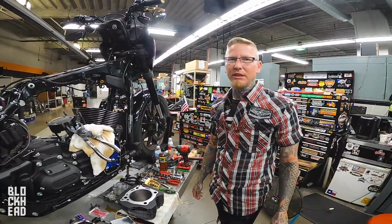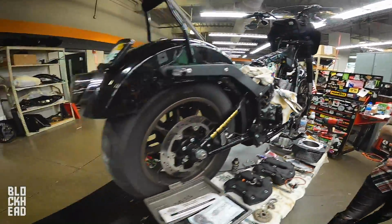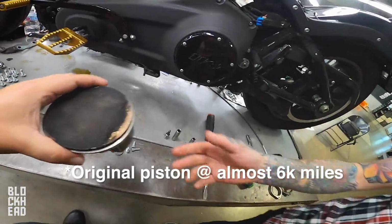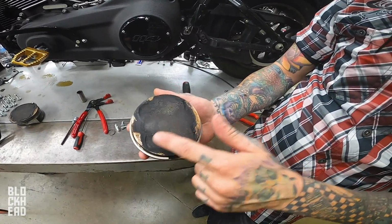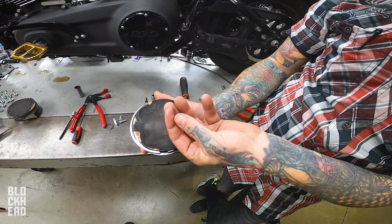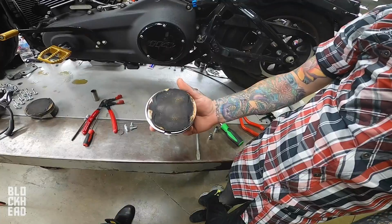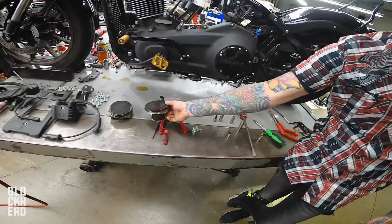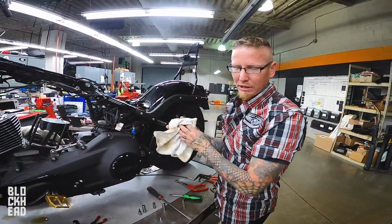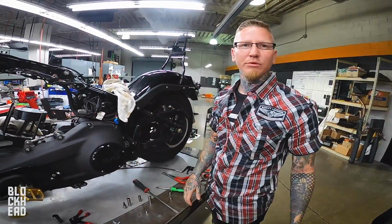I think some of what we were having an issue with was ethanol, and somebody sent a picture of spark plugs that matched the pistons. And really, just to settle this, we're technically right. When you look at this, if you say, well, that looks like oil, technically yeah, there's some oil in there for sure. But this white crystalline stuff that's coming off, I don't know if you can actually see this chunk on my finger, but this is from ethanol. See that stuff falling off? That's byproduct from ethanol. And really the black is too. A lot of it is more ethanol than oil, but for sure there's some oil in there. Eric, I think is your name, you're right. It's just a byproduct. Like I said, if I had a set of pistons here that was running only unleaded, we could truly compare apples to apples. But right now we don't.